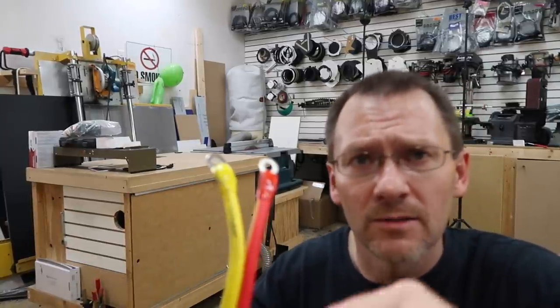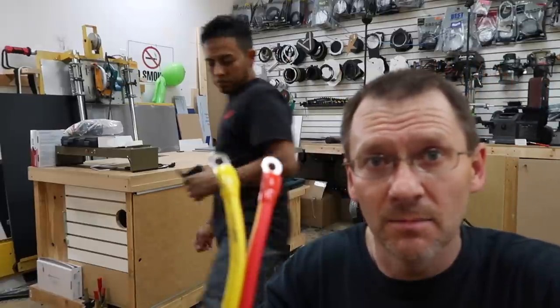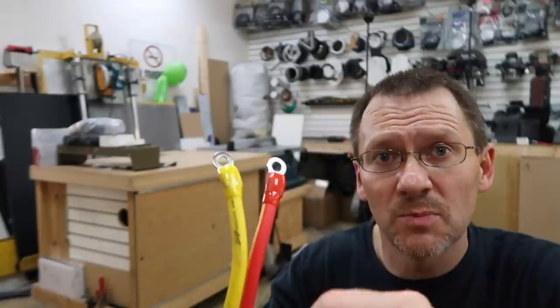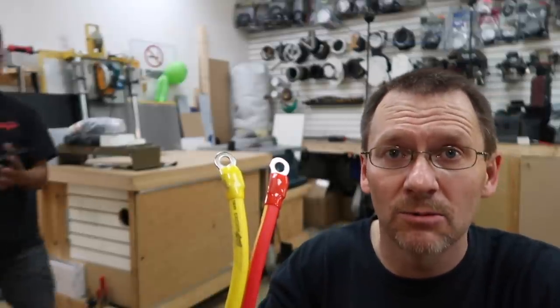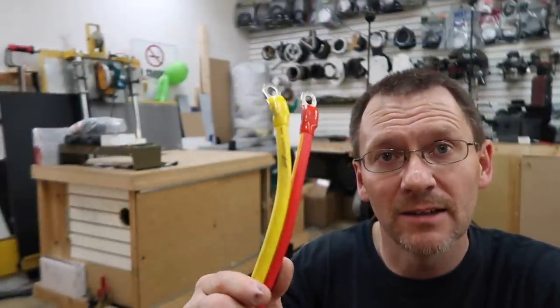The reason why we did that is because it's a Corvette, more like a boat than anything. But even though it has a frame, you have to get to it. And a lot of the times, it's very difficult to do that. In this case, we figured it would just be easier to run a power and a ground. Now, most of the time, you'd run equal length power, equal length ground. Two wires, but now that Stinger has this, this makes it really nice.